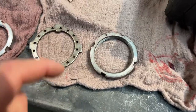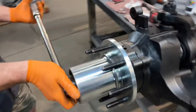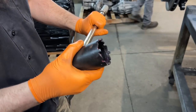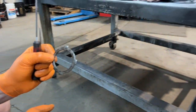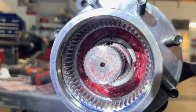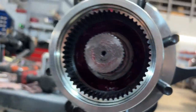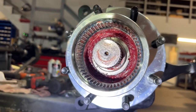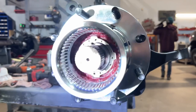Here are the spindle nuts. The first one to go on is this one that's got the little dowel pin on it. We're going to put it on the spindle and torque it to 50 foot-pounds. This does require a special socket — they're available at pretty much all auto parts stores. Next up is the lock washer. This is the trickiest part of the whole process. You see that keyway at the top of the spindle? You have to line that up with the keyway in this washer, but you're also trying to line up the little dowel pin, which is right there at about 7 o'clock. If it doesn't line up, tighten the first spindle nut until it does.